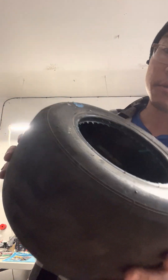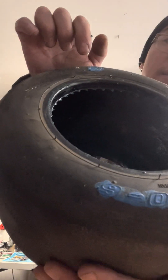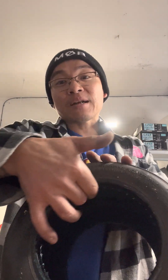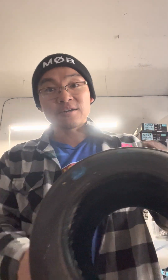If you're doing a Vega or one of these Unilis tires, do you see those little rubber hangers back there? Those are actually probably preventing you from putting your tire on all the way. When you get the lubricating stuff, you've got to put it all on the inside — it's not the outside of the tire that matters as much. You've got to lube up the inner lip and those inner little flappy things right there, otherwise your tire's not going on.